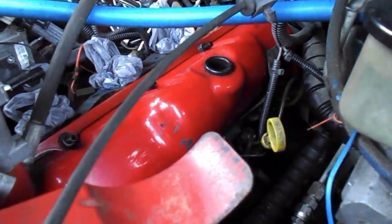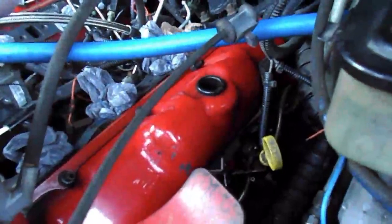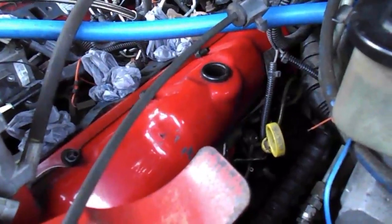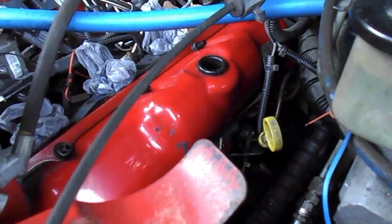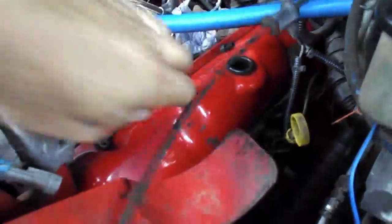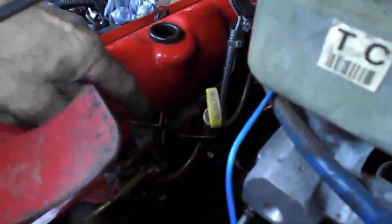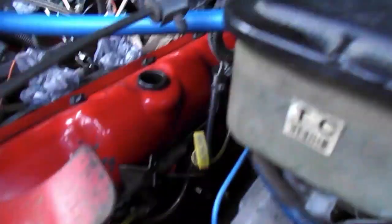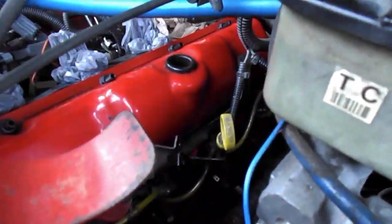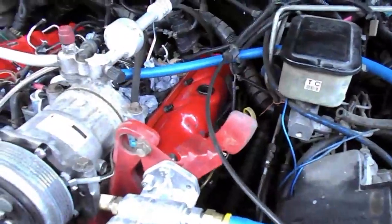There's also a possibility you may need to flip this girdle — if it won't go down one way, just flip it over and try again; it will go. There's a real tight tolerance these things are cut at. Then put this bracket here — snug that up, put the dipstick mount back where it was, and then it's just a matter of putting everything back together. Put the hard lines back in and reverse the process. Any questions, let me know. Like, subscribe, comment — all that good stuff. Have a good day.